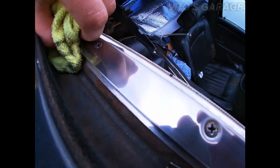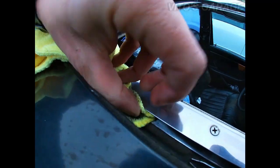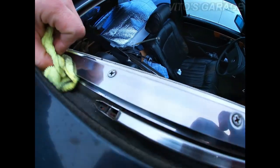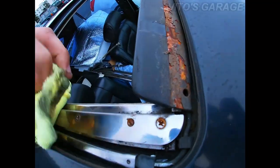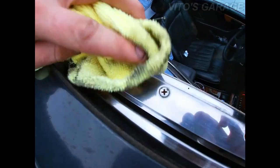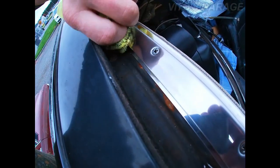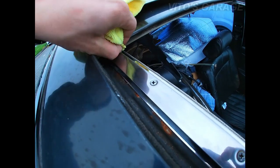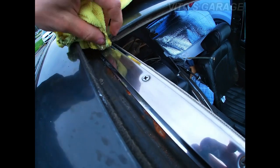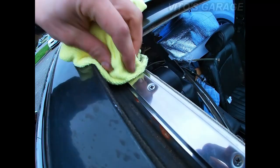It's a really good idea to grab a pick or something and a cloth and go under this thing — go under where the actual tracks are and clean that area pretty well. Clean all this stuff, because it's basically preparation before we apply the grease. It's like doing a paint job — first you sand and prepare the surface, then you apply primer and base coat. Same thing here.